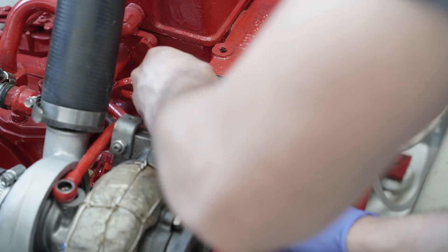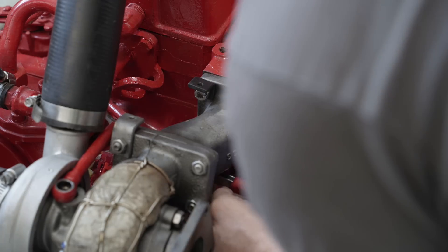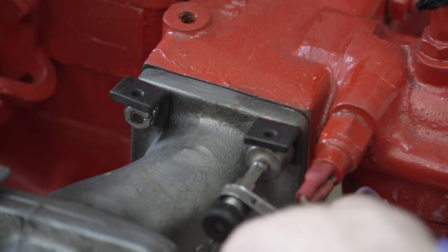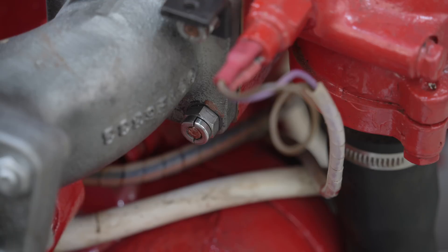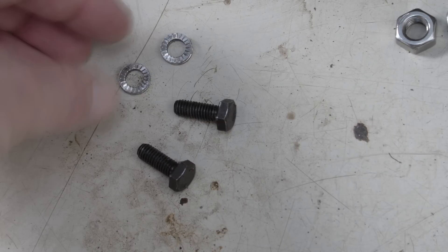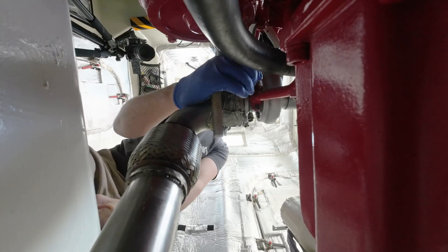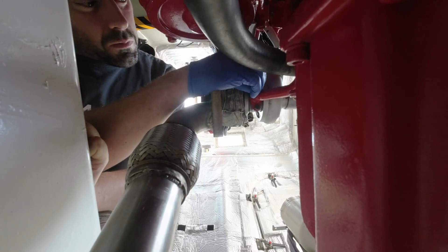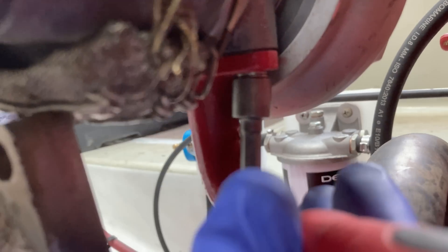I categorically didn't forget to fit those, have to remove the nuts, and then do the whole thing all over again. I whined and complained enough in the previous episode about how awkward the angles were, particularly for the lower left nut, so this time I'll show you effortless triumph as we complete the mounting of this part of Alan's turbo. On a high, attention can turn to the oil drain fitting — this involves a couple of little bolts I've cleaned up. They came with spring washers, so I'm using Nordlocks instead here, zinc coated instead of stainless. I had to do this pretty much by feel, and the first one went on fine, but the second was awkward and I was scared about cross-threading it if I tried to force tighten in a peak of misguided optimism. But finally, that too was on.